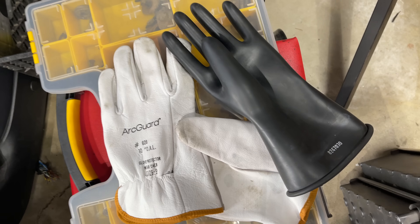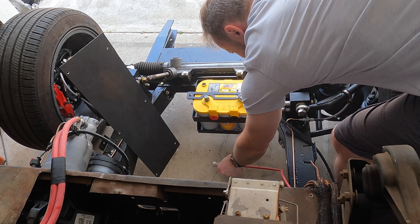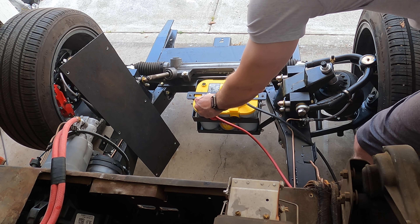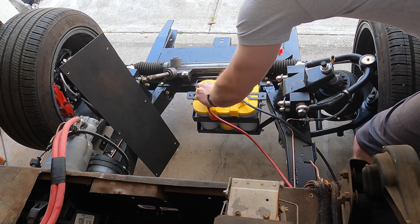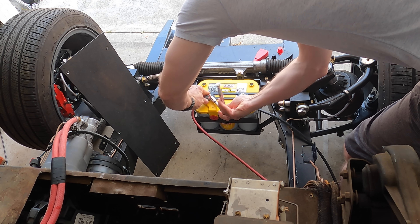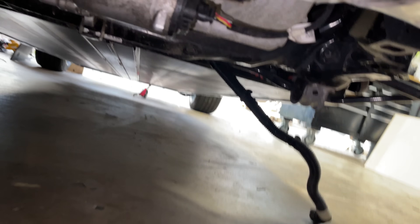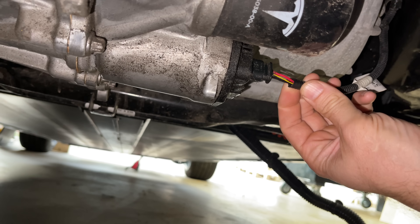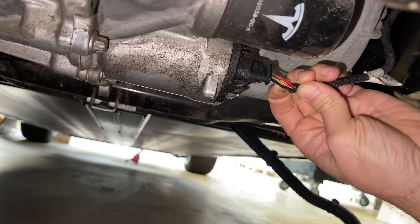Definitely all of this work needs to be done with the correct high voltage gloves. Then it was time to connect the 12-volt system. The high voltage battery needs the 12-volt system — it uses it to slowly ramp up the voltage before closing the contactors, so you don't get a huge arc across the closing contactors. Remember, spark is good on an internal combustion engine, bad on electric vehicles. You probably also hear what sounds like a small electric motor running — that's the oil pump. The oil pump always has 12 volts running to it, but it also has a communications wire going to the drive unit, which measures temperature and requests the pump to run at a certain speed.